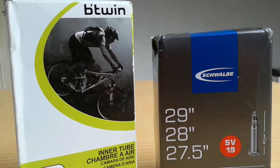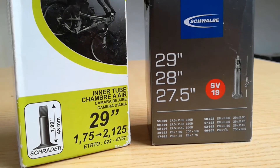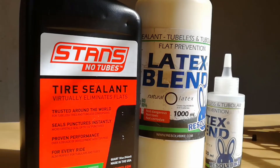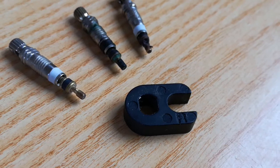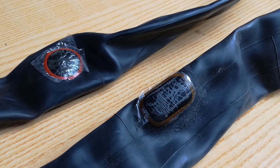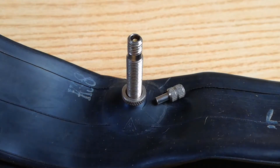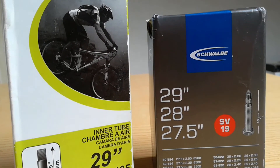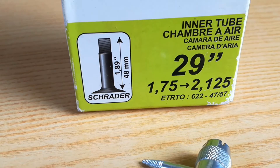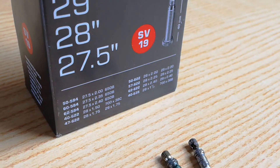Let's see what you need. Two new tubes about the right size for your wheels — 26, 27.5, or 29 inches — a valve core remover, and some tire sealant. If your bike tubes are new and suitable, you can buy only the sealant and core valve remover, making this an option that starts around 10 dollars. You can't use old tubes if they have patches, because they will compromise the conversion. Also, you can't use them if they don't have a removable core valve. Suitable tubes come in about 2 kinds depending on your rims — check the valve hole. If it is large, you can use Schrader tubes with a large valve. If the rim fits only thinner valves, you must buy a Presta valve tube with a removable core.